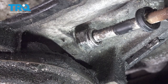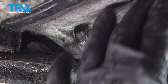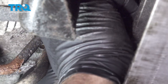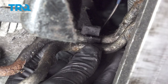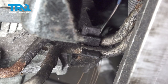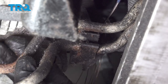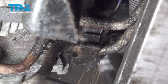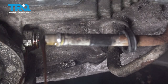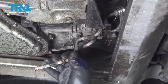Now you want to have a catch can or some towels underneath — you may experience some transmission fluid leaking out of this line here. Right up here, there is a little retainer that is holding our transmission lines in place. That will release our cooler line; go ahead and wiggle that out and work that line out.